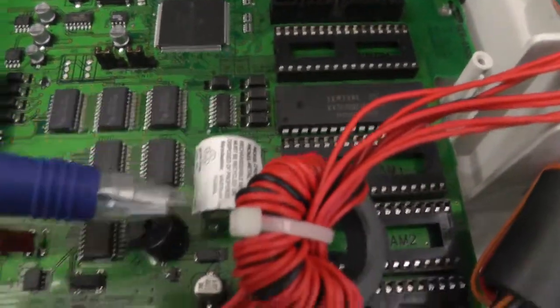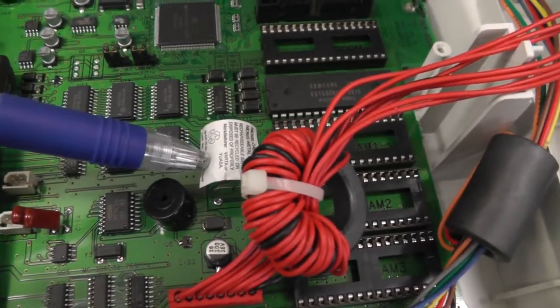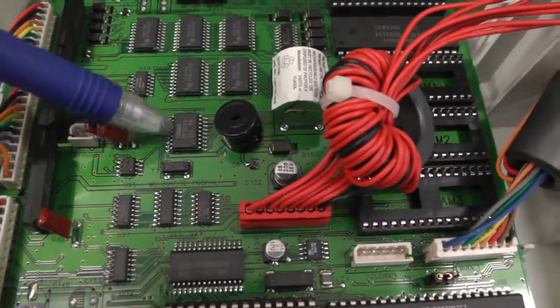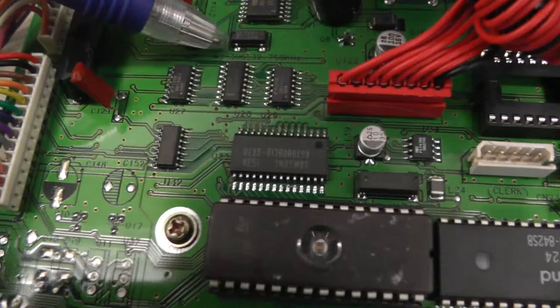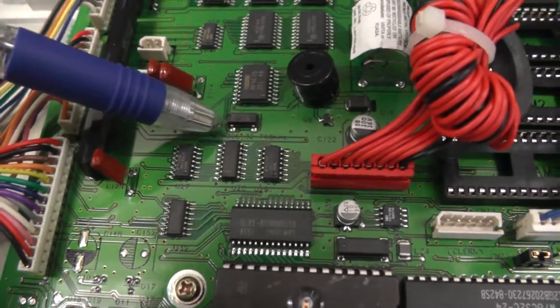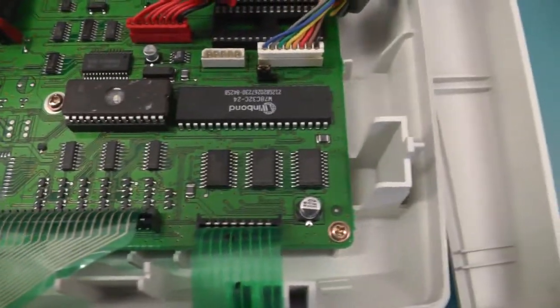And on this side, we have the backup battery to probably keep the memory intact, but also to provide this real-time clock. This is a real-time clock with, here we have a 32.768 kilohertz clock. So quite typical for real-time. And here we come at the bottom.